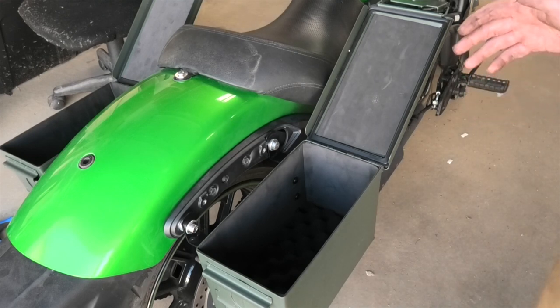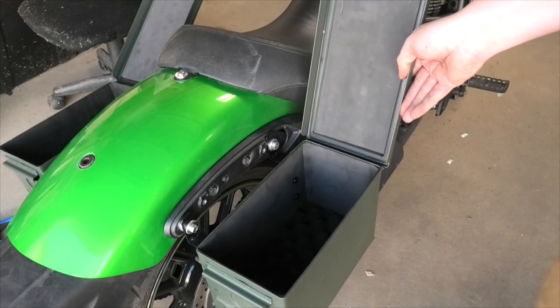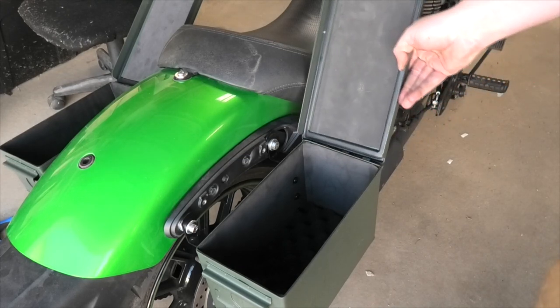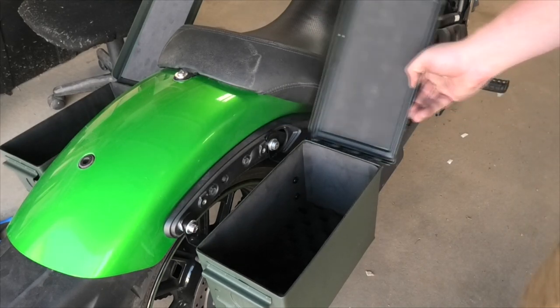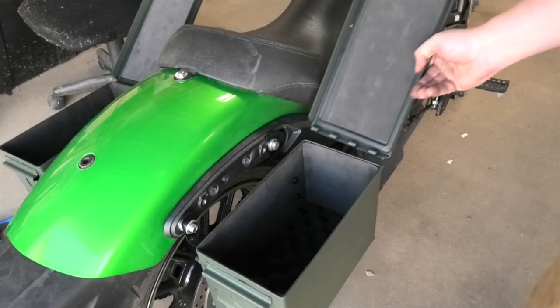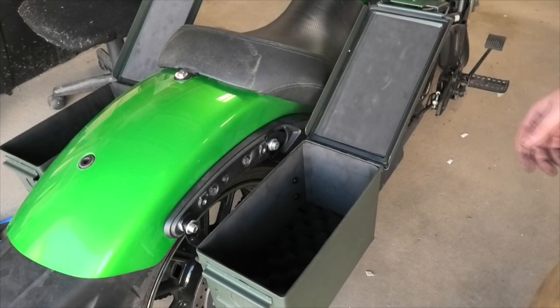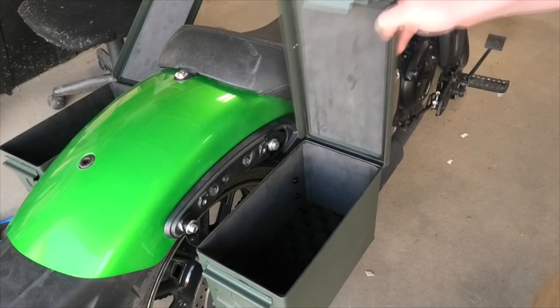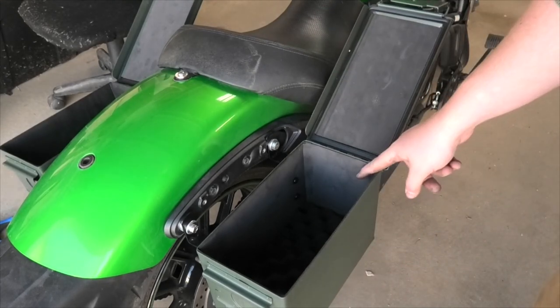I did make one mistake, and I'm going to tell you what that mistake was so that you don't make the same mistake. On these ammo cans, you can remove the lid by sliding it sideways. The mistake I made is that when the bike is tilted over on its kickstand, gravity wants to pull this lid sideways so that it comes off — sometimes if you close it too quickly it'll just slide right out of there. I'll probably just modify these hinges a little bit so that the lid isn't removable at all, but it's something you should be aware of. Make sure that gravity is holding your lid in place and not actively trying to remove it. The reason I put them on this way is because I wanted the hinge to be at the front so the wind couldn't blow the saddlebags open, but with a container this robust you'd be better off worrying about which way your lid slides.